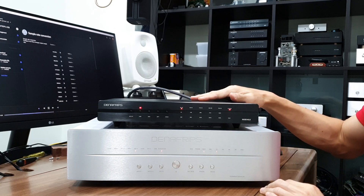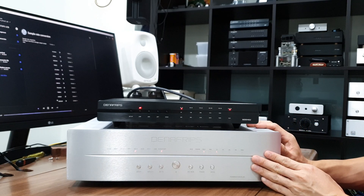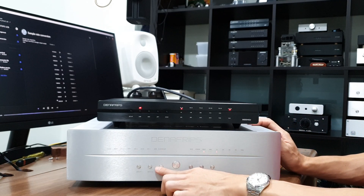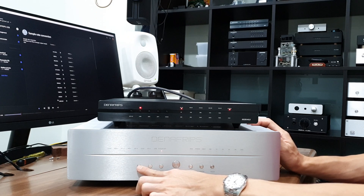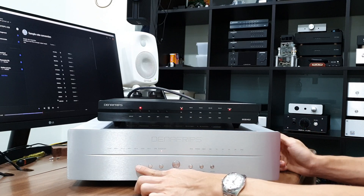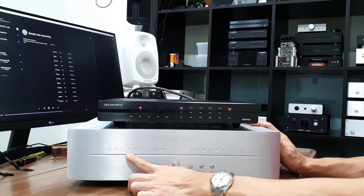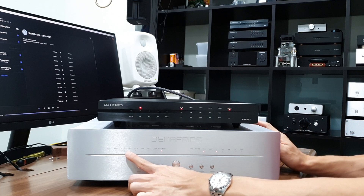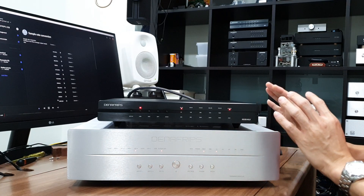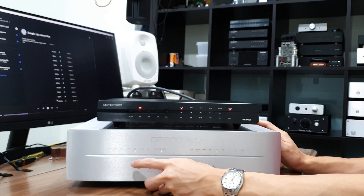For clock synchronization, you'll notice the clock LED is on on the Hermes DDC — it's expecting an external clock connection from the Terminator Plus. To configure the clock output of the Terminator Plus, hit the mute button; as mute engages, the LEDs turn on and off from left to right. Then hit the input minus button — the coupled LEDs will light up and cycle. In one of the modes, the clock out LED turns off, which turns off the clock output — that's not what we want. We want the Terminator Plus to output 45 MHz and 49 MHz to synchronize with the Hermes DDC or Gaia DDC. Leave the LED on at OPT — at this setting, the DAC will output 45 MHz and 49 MHz to match the clock input requirement of the DDC.